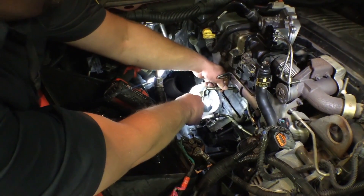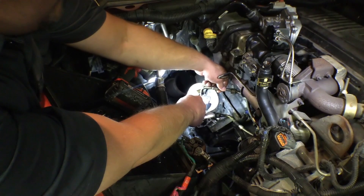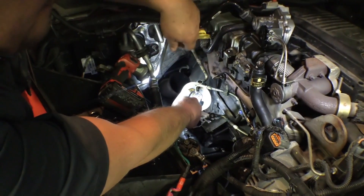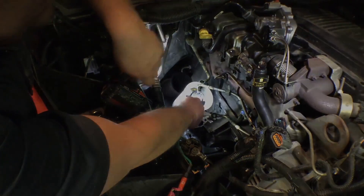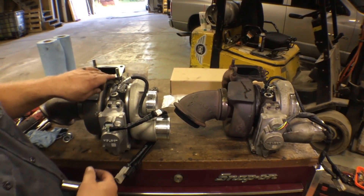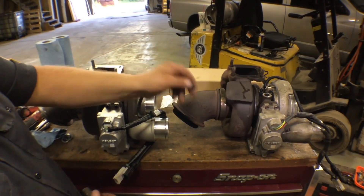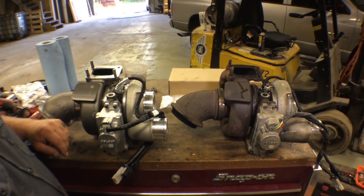As you can see, we've got a good steady stream of oil. We had to do a little bit of cranking first because the line was off and some oil had bled out, but once we got the air out of the system this thing had a good steady stream of oil flow for the turbo. We're now confident that when we install our new turbo we're not going to be starving it for oil — this is always a very important step. We've got our new and old turbo sitting side by side. We've already installed the new studs that came with the new turbo, and the only thing we need to transfer over now is the oil fitting. Our new kit came with new o-rings to seal it up, so we'll swap that over and we're ready to install.